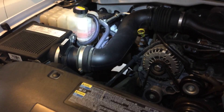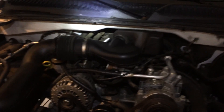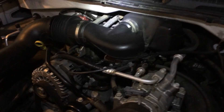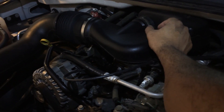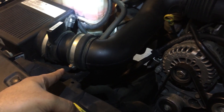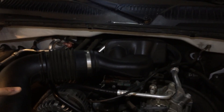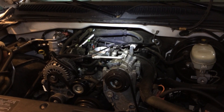So what you'll want to do first is loosen a black wingnut. You just spin it by hand right here, and after you do that you can come over here with a flathead screwdriver and loosen this up. Then this whole entire assembly will just lift right off so you can get better access to the distributor, which is way back there where my light is flashing.